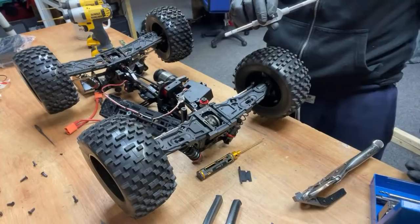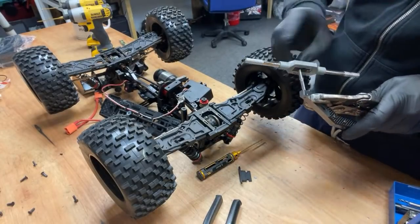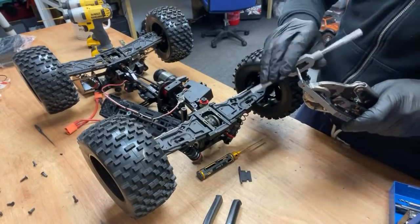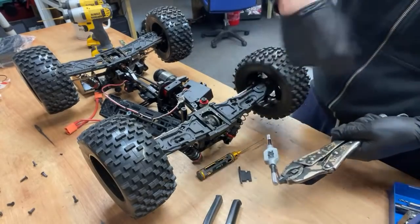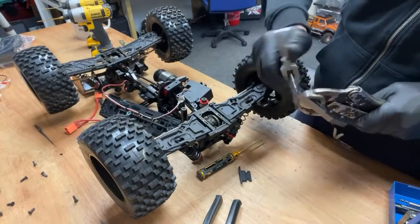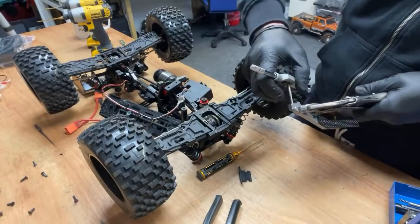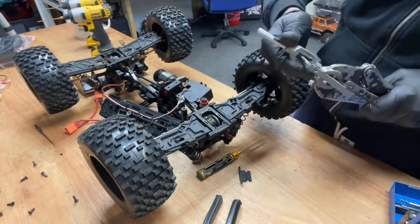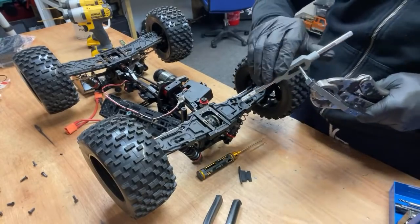Need a drill press, Kev, says Fred. When I get a new shop, I'm going to get a milling machine. I don't like pillar drills or a drill press because you have to hold the thing that you're drilling. And then when it starts slipping, the whole thing can start spinning around and getting you. So I'm not a fan of them. I would much rather get a milling machine with a proper vise. You can clamp it in there, then you can move the X and the Y axis to get it into the perfect position. And I want a milling machine anyway, so there's no point having a drill press or a pillar drill.